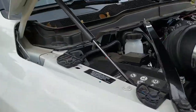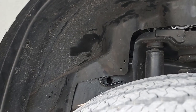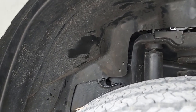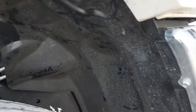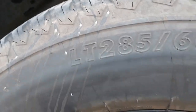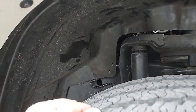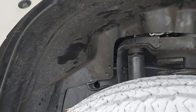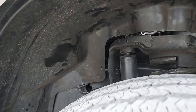It'll give pretty much the same readings, I would assume. The only way I found to do it is coming from the side — you might be able to do it from the bottom but you'd need like two and a half feet of extensions, and that's just not going to work. I was able to take this liner out; you've got two of these clips, one there and one over there, and the rest is just screws. If you remove the tire it makes it a lot easier. I didn't use a jack — I'm a pretty small guy so I got in there with a standard-sized DeWalt drill and was able to drill and tap it from the side and get the probe in. So it can be done.